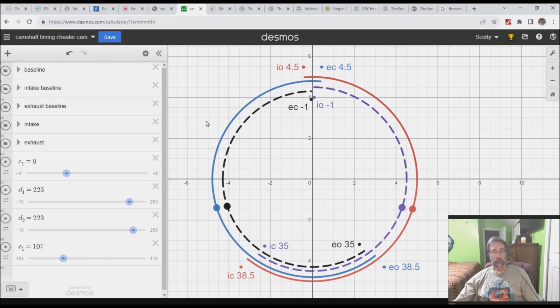This is relevant, not necessarily to the general automotive guy, but if you're an airplane guy, this becomes valid. The airplane people who are watching my channel, what you guys have is something really, really specific. You need to get the peak torque, operate there at high throttle loads, and never really go past it. So an automotive camshaft is really a bad choice for you guys. So what does that leave you? It leaves you custom camshafts. In order to do a custom camshaft, you kind of have to know what you're doing, which leads you into the valve timing events. Way too much information for this little video.